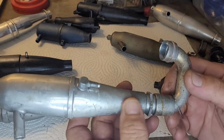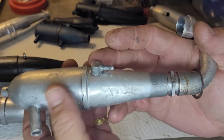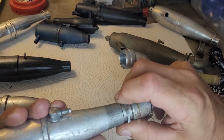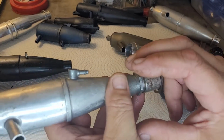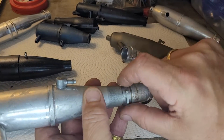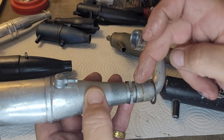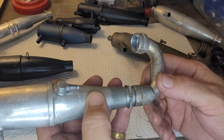But a very unique pipe. There's a coupler in here that, let's say you have the pipe and the coupler mounted securely, you can spin this coupler and adjust the length of the pipe, shorter and longer, without removing it from the vehicle. You can just turn that turnbuckle essentially and adjust the length of it. There are O-rings fitted into it to keep it from leaking.